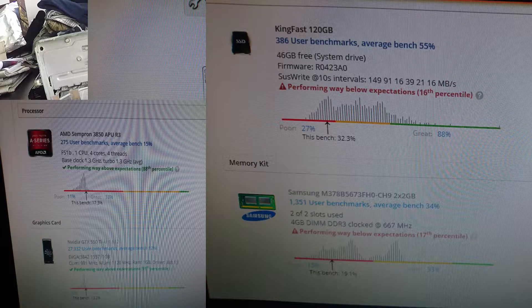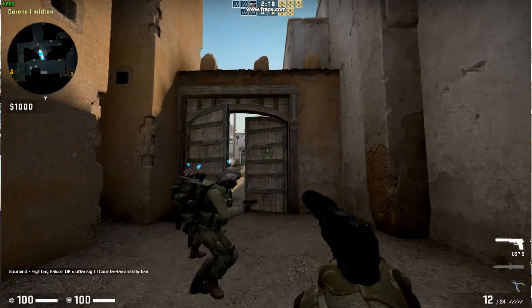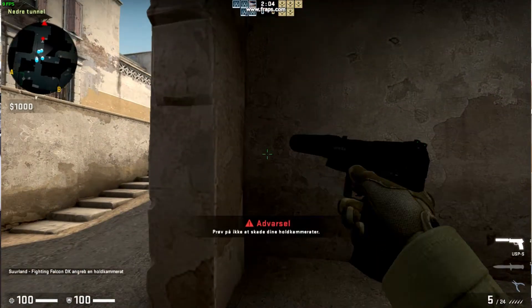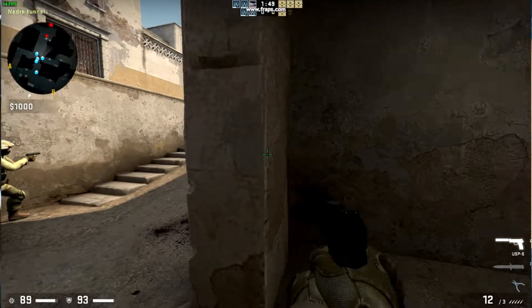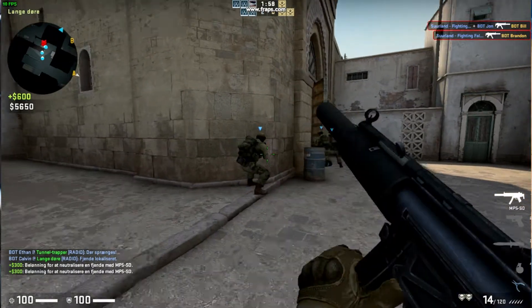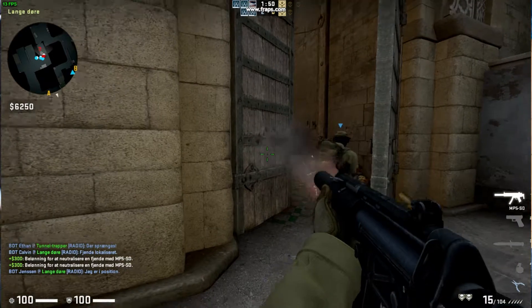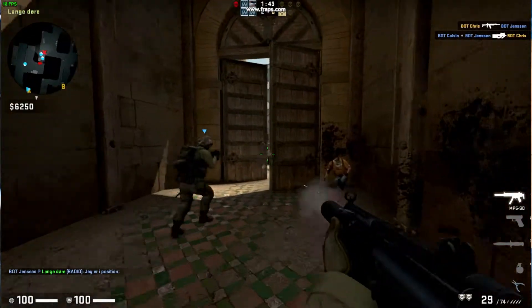Pretty much confirming that this system is somewhat useless. It's pretty clear in my final thoughts that we are experiencing some bottlenecks, either from the PCIe x4 slot or the CPU. Looking at the GPU and CPU utilization graphs, it looks like we're seeing a CPU bottleneck most of the time, but at times neither the CPU nor GPU are maxing out — which makes me think the PCIe x4 slot may be contributing. In other tests it's clear the CPU is maxing out while the GPU is not.